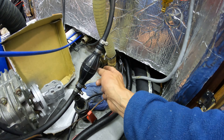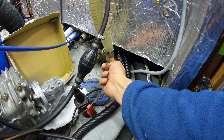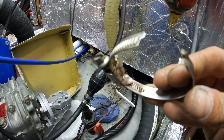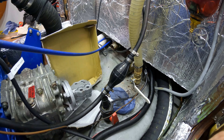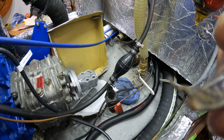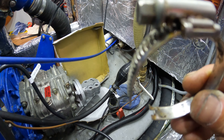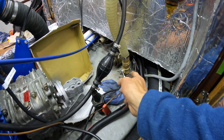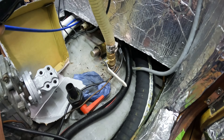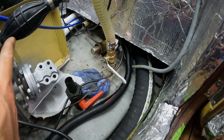There's only one Jubilee clip on here because just as I was tightening the second one to refit this hose, it went and snapped — right here. I think I've seen this before online: it doesn't take much for these to snap once they start getting a little bit corroded. I'm guessing this is not proper 316 stainless steel because there is rust. I need to go to the shops and replace this Jubilee clip. Two shiny new Jubilee clips fitted — jobs a good one.